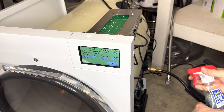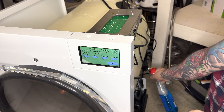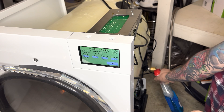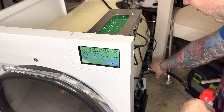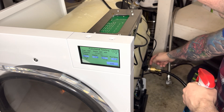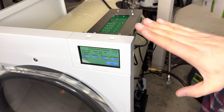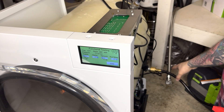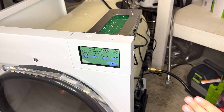The next place we'll check out is this hose area. I personally sprayed the hose first, all around that hose. As you see I didn't get any water or Windex in this area here, so if I see a change in the mTorrs I'm going to be able to identify the hose is most likely our issue. Because I'm not really expecting it and I want to make this video a little shorter, I'm going to spray the next area already.